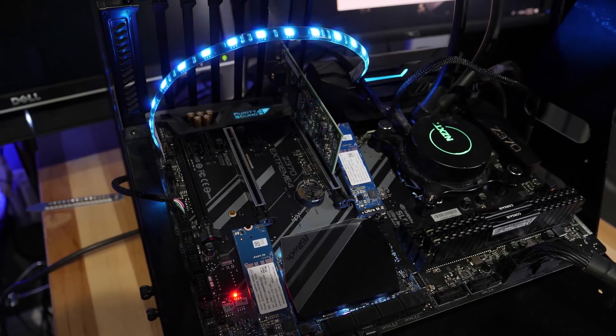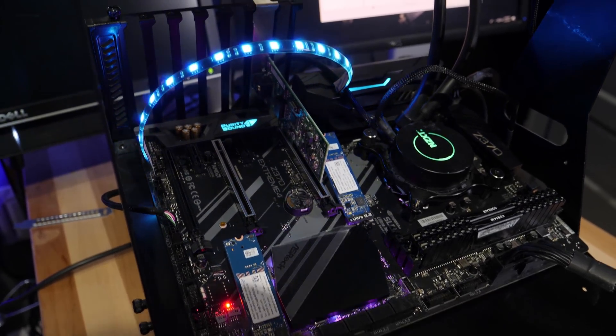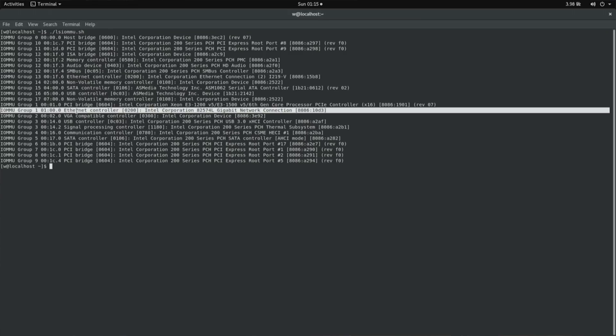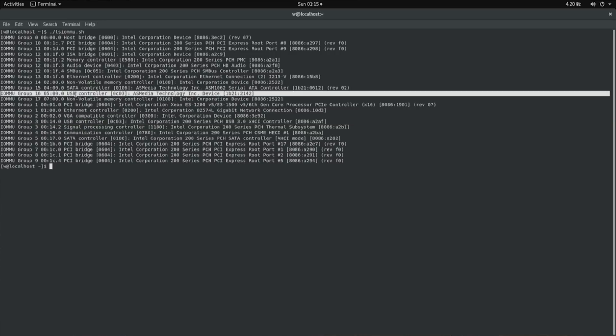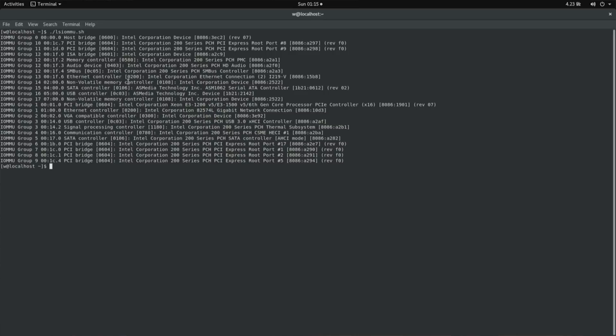In short — what is it with this motherboard? I can't really tell that they cut much to save on price. It seems pretty solid. If you're curious about Linux support, this motherboard works well with Linux too. You can set the RGB and fan profiles directly from the UEFI, so you don't need a utility for that. The IOMMU groups on this motherboard are pretty solid as well. After the outro there's a full tour of the UEFI if you're interested. If you end up using one of these in a build, share with us in picture form in the forums at Level 1 Techs. I'm Wendell, signing out.